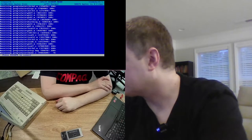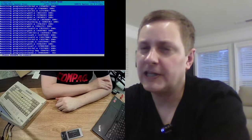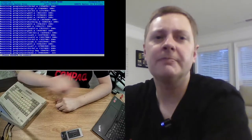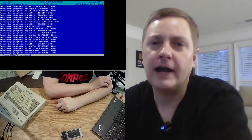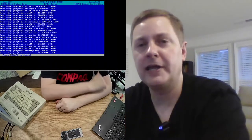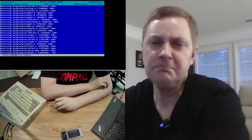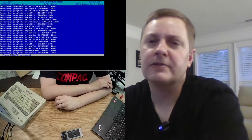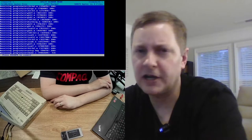And it takes a long time to copy over and takes up a lot of hard disk space. Probably what I'll end up doing is I like to install DOS and 3.1 on these, and then I like to install 95. So I dual boot them with Bootit, as you saw. And I'll probably make a common partition where I'll put Oregon Trail, and that can share between the 95 and the 3.1. Because this machine, I think right now, has a 1.2 gigabyte drive in it.